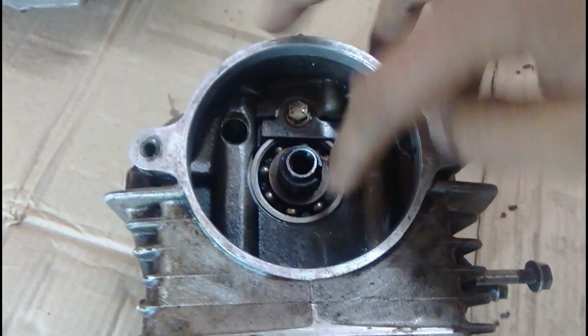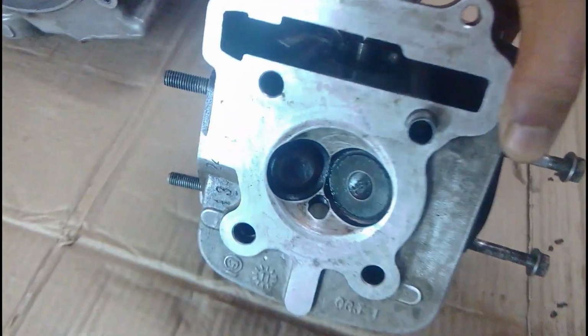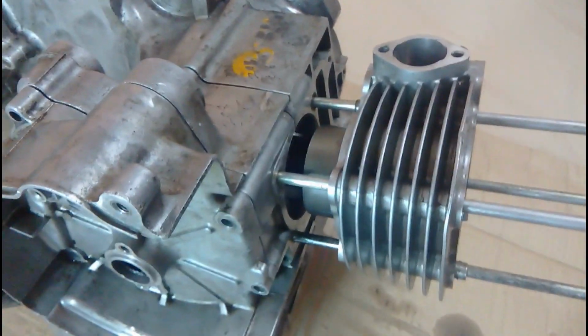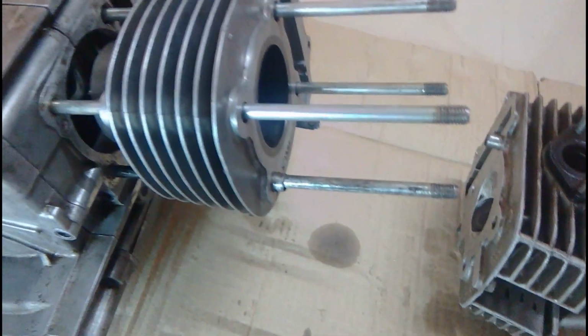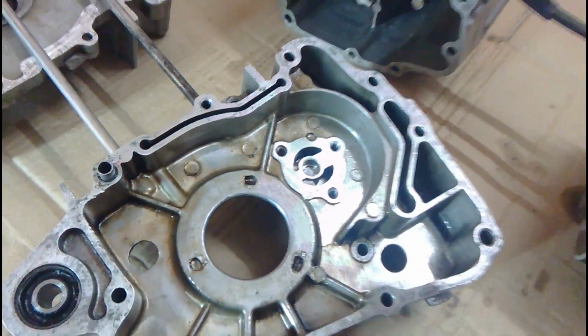Now as the oil goes in, the camshaft rotates, and it throws the oil everywhere and comes out from passages, and it goes down the crankcase through this way, where the timing chain cavity is. The oil returns through here, and it returns to the crankcase after lubricating the bearing on this side of the crankshaft. As the engine rotates, suppose the engine RPM is 2000, then the camshaft RPM is half of it, as it's a four-stroke engine, and that's how the camshaft throws the oil everywhere.